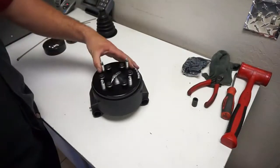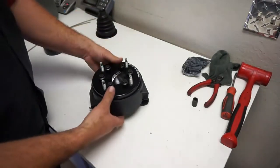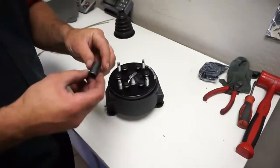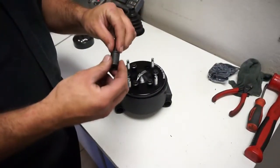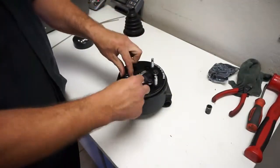Alright, you just bought our SR1 Super Hubs, so we're going to go over a couple of details. When you get them, basically it's going to come something like this. I've already loosened up the bolts. The bolts are a 12mm 12-point socket, so it's like an ARP 12-point bolt. So once you get it, basically you're going to take the bolts out.